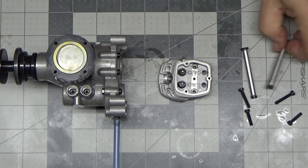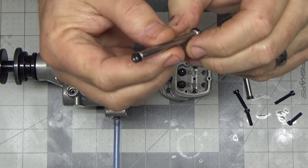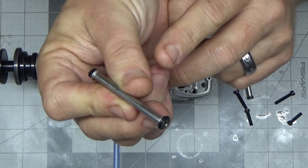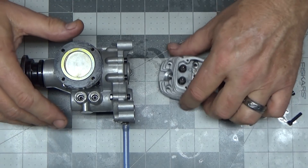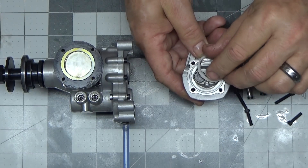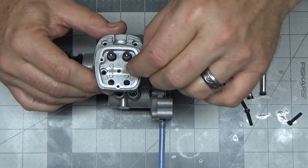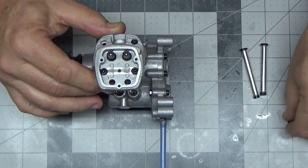I'm ready to install the head on the left side now. These pushrods — the rubber on these little O-rings up at the top were really brittle and they broke, so I don't have replacements. All I've got here is just a small piece of heat shrink tubing that is not heated down — it's just there to act as a little spacer. At the bottom, I was able to find some little O-rings in my Harbor Freight kit that should work fine for that area. So I need to put a drop of oil in this channel because that's where my head shim is going to go. The longer screws go in the back and the shorter screws go in the front — right now I'm just going to engage these by a couple of threads so I can fit my pushrods in there.